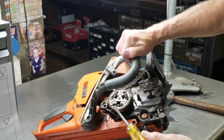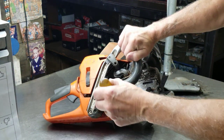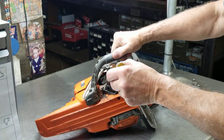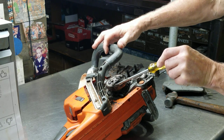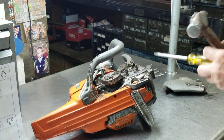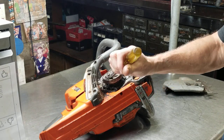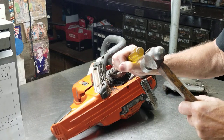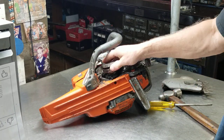You're going to put that screwdriver right on that lip right there, but you're not going to have it tilted up — you're going to get down as low as you can get. Have the saw on the side; you can see the angle I'm at there. I'm very low. Then you give it a quick wrap, and that knocks that clutch off.